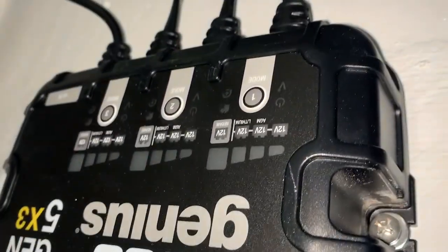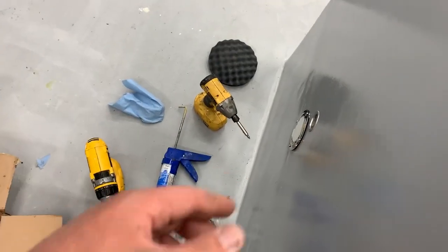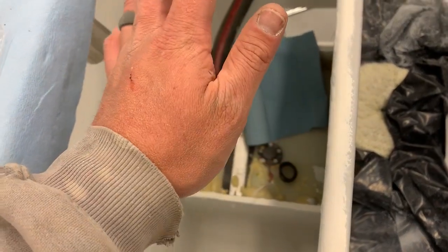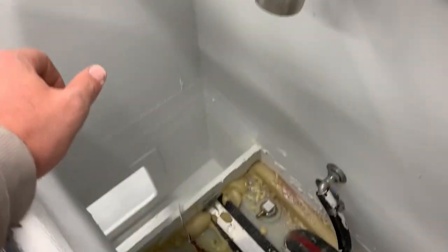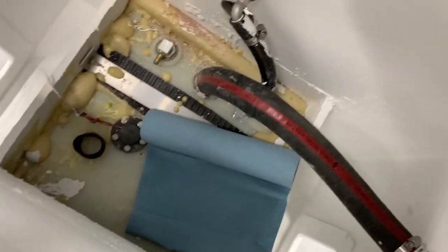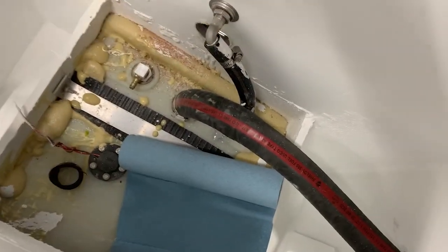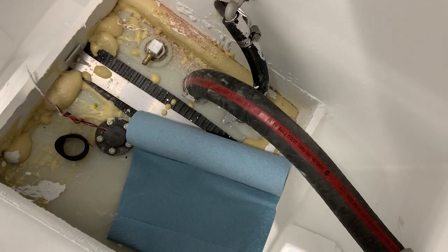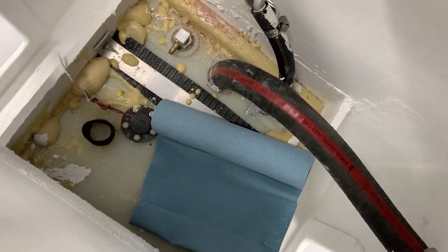I'm tying everything up. I've got the bin in for the tank and I went ahead and put a vent in for that area so it's properly ventilated. It's got three hatches that aren't airtight, and with the vent I think we'll be safe. Then I ran into a brain teaser — I almost forgot I need to ground everything in here. The grounding diagram from Moeller shows you're supposed to ground the fill with a number 10 or 12 wire to the battery negative.